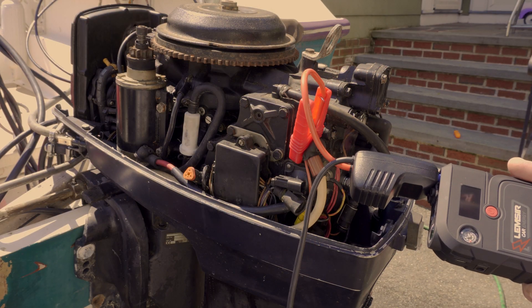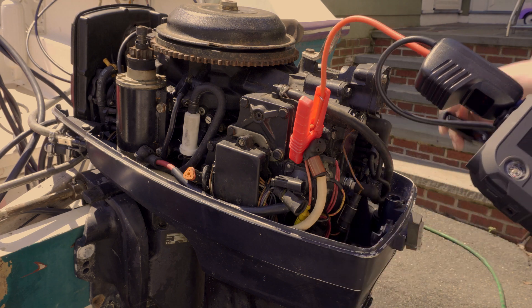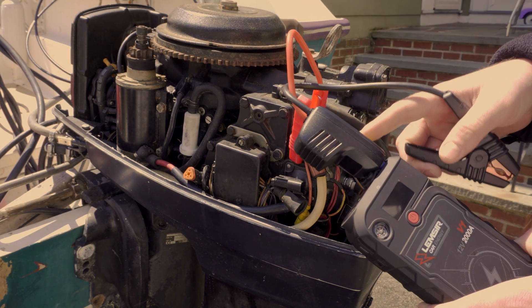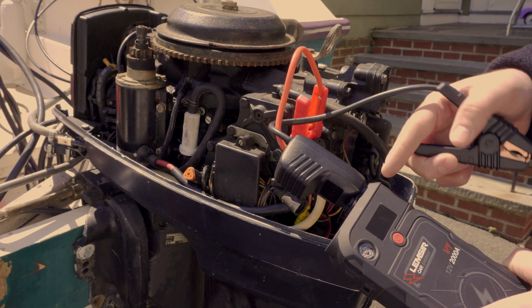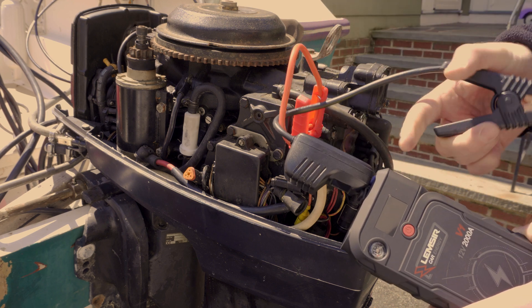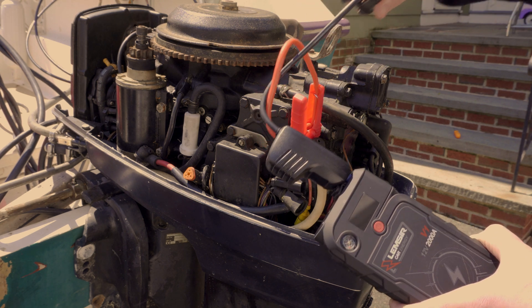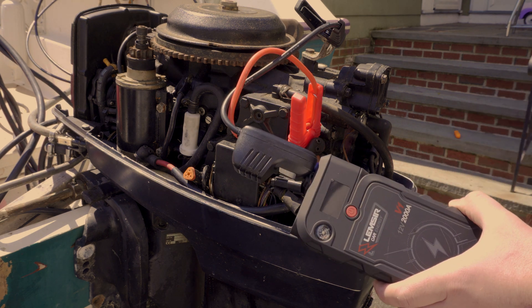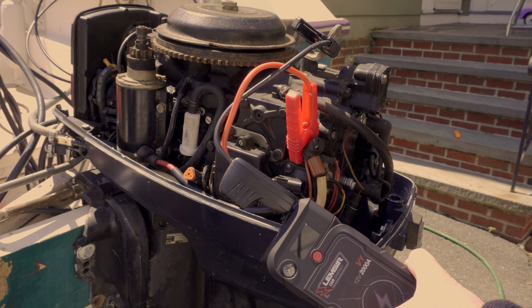The current was very strong and it started up really well. A quick tip: when you first connect the device, you'll hear a click meaning the capacitor is ready. You have a few seconds to start it before the next round. Once the capacitor runs out after about 10 seconds, normally you'd press the power button again. But with this device, I found it easier to just quickly disconnect the ground and reconnect it — this re-engaged the device much more reliably than pressing the button when running back and forth to the engine.